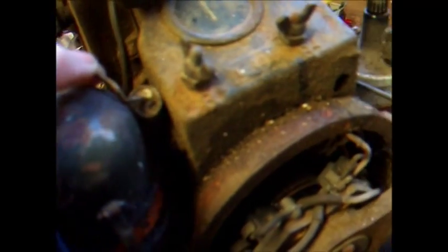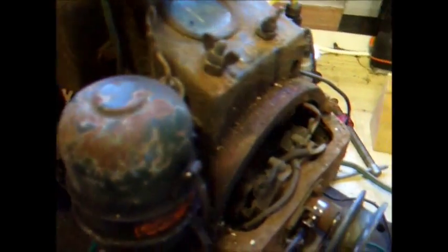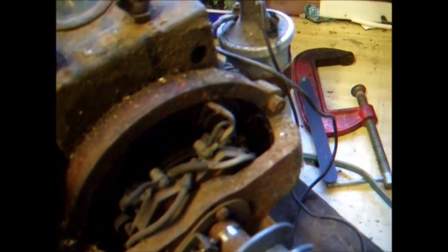There's something interesting going on here — it looks like another condenser has been put in, but it's literally just been installed and put onto the positive terminal. I'm not sure what that's all about, so I removed it. I do have a spark, but I have a little bit of sparking at the points, so it definitely needs a new condenser — but that's no big deal.